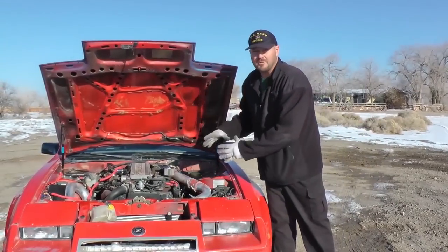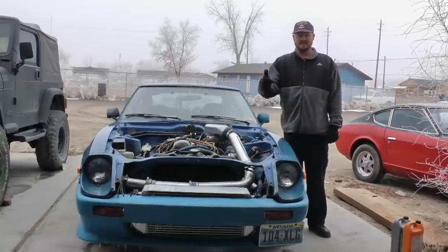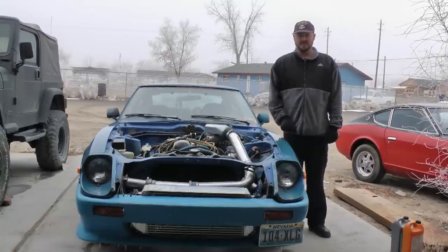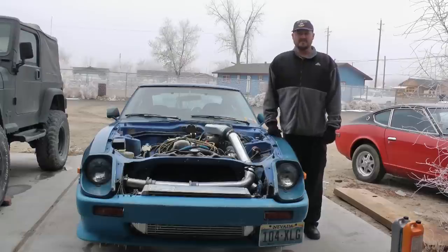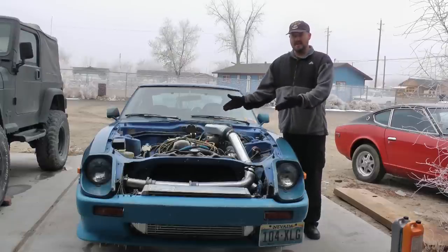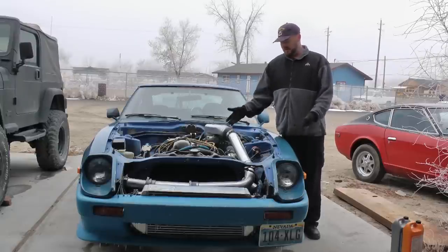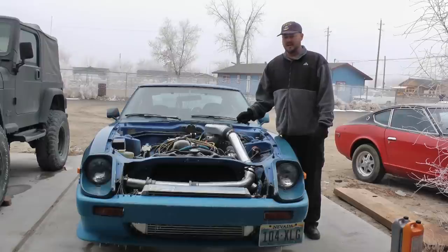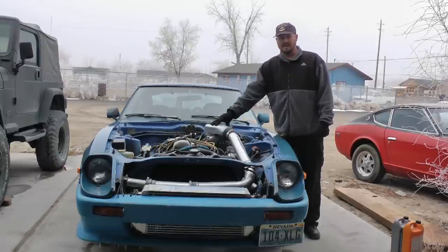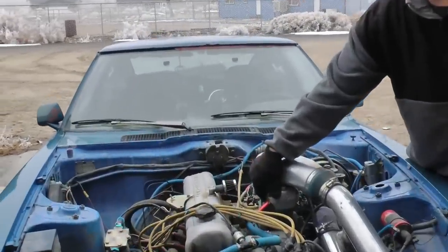From the factory they had a very small turbocharger, no intercooler. Hey, this is Mad Matt's Garage coming to you from Budget Boosting. Today we're going to talk about blow-through carburetor setups, and instead of using props like we did for draw-through, we actually have a blow-through carburetor setup car — a 1979 Nissan 280ZX. This turbo kit was pieced together from a lot of different sources; for example, this carb hat I got lucky and found on eBay, and this Demon blow-through carburetor is designed for blow-through application.